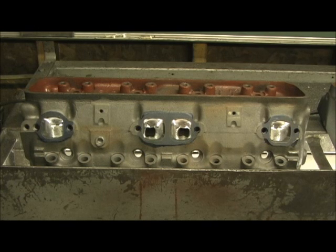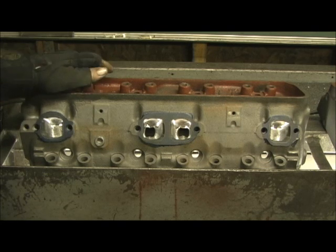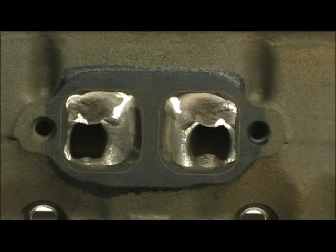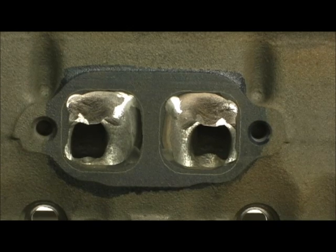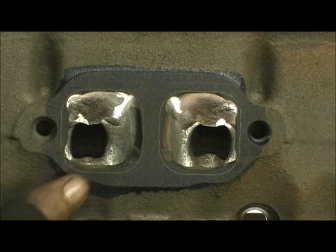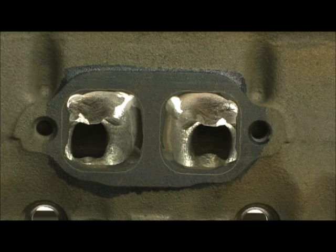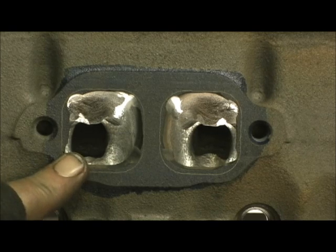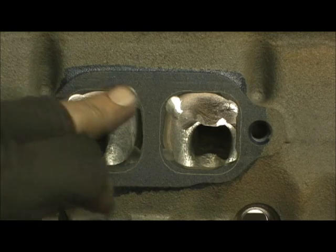Now that the cloverleaf is done — and that is a term I use because it reminds me of a cloverleaf — it refers to going in here and setting the corner depth. I've used this method; it's what I figured out on my own, because back when I did it, cylinder head porting was a black art and nobody wanted to teach you anything. This is the burr I use for raw material digging. I form the corners, bring it out to the edges, and the cloverleaf marks are on the bottom on each side and the top on each side.